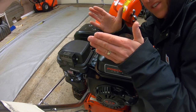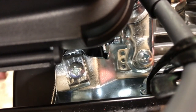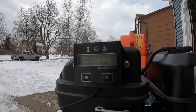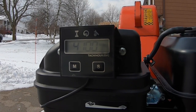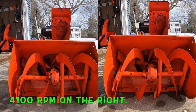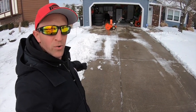Mark it just in case you need to reset it — that way you know exactly where you left it. This throttle screw has the important job of stopping or limiting your RPMs, so we're going to put a minor adjustment on it. Park the snowblower outside and turn it on. Let the engine warm up for a few minutes to achieve a steady RPM level. Once running steadily, take your screwdriver, locate the throttle screw, and begin turning it counterclockwise in quarter turns — slowly bring it up to 4,100 RPM. I'm only turning this engine up about 300 RPM, from 3,800 to 4,100. Here's a comparison of the auger spinning at 3,800 RPM versus 4,100 RPM — you can see everything is moving a bit faster.